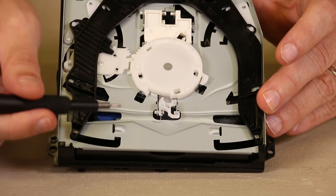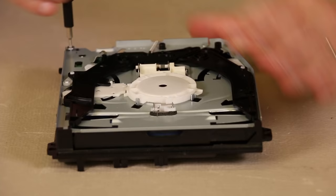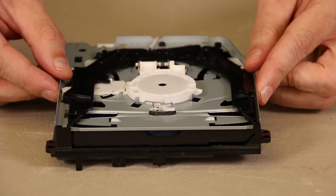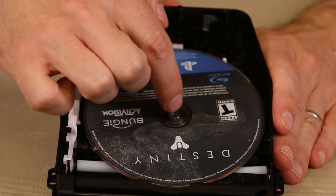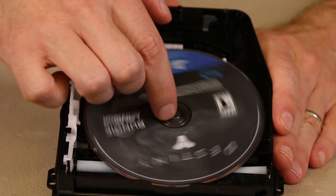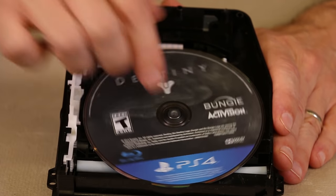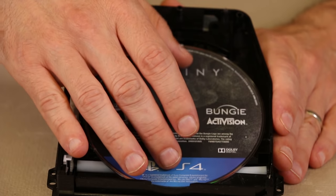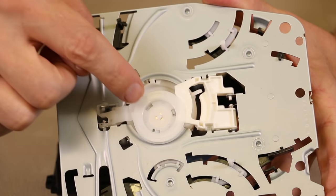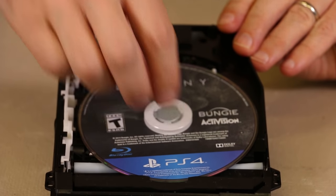What I'm going to do now is remove this metal plate so you can see exactly how the disc is located inside the disc drive. With that metal plate removed, you can see how the disc is right here and we can spin it just a little bit on the spindle with our hands. You may be able to hear the disc rubbing — that's because there's a magnet that goes right over this piece that keeps it from moving back and forth. The magnet is located right here on this metal plate we took off, and we can actually remove it and place it right on top.